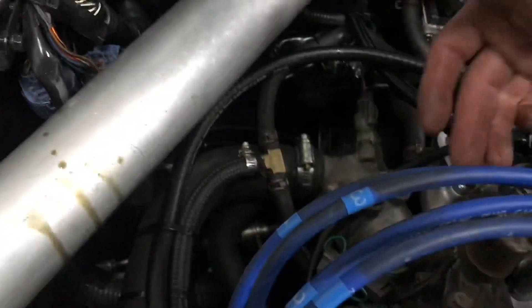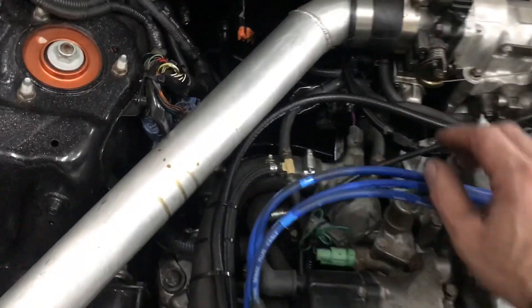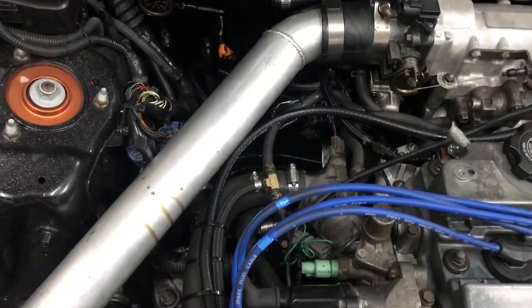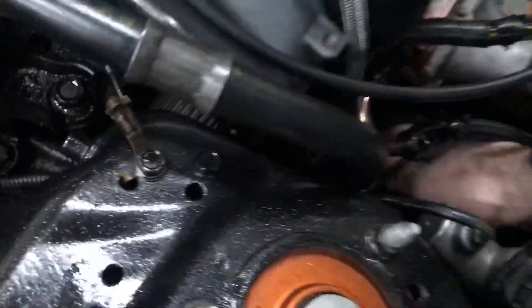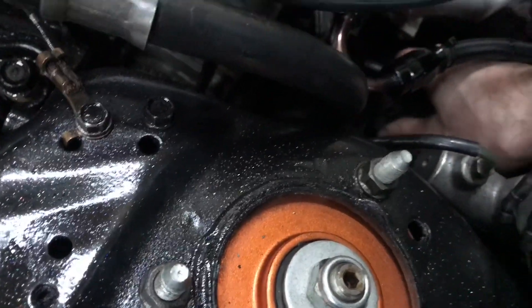Back here, take that plug that comes off of your coil — I took the whole coil assembly off and now it looks really nice and clean. You put that 25 amp fuse in there, then electrical tape it up and zip tie it away. Down here you're going to have a harness — it's probably going to be difficult to see — and you're going to find your crank position sensor jumper plug.